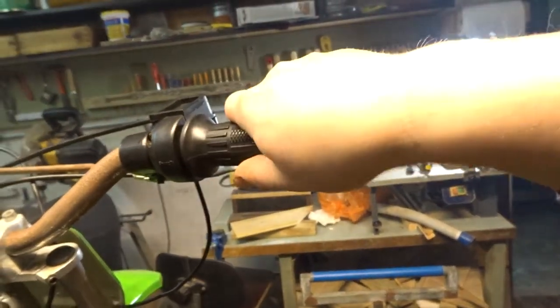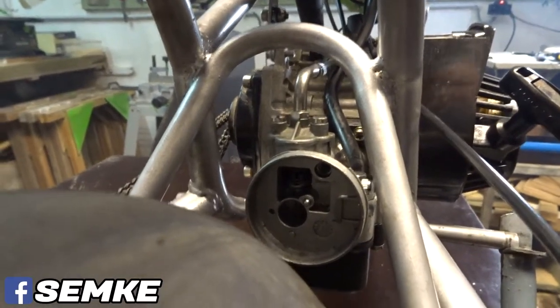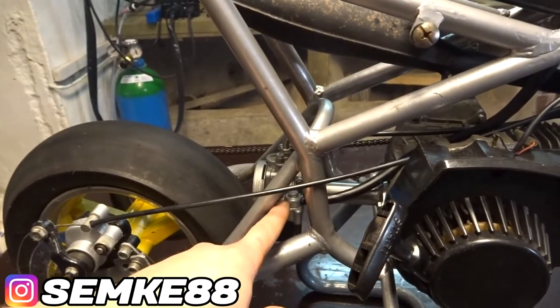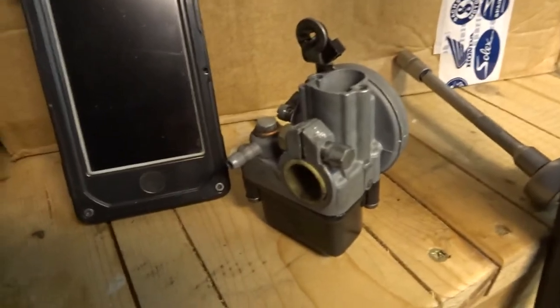The throttle is connected — as you can see, it moves up and down. But what you may notice is this is not the smaller carb. This is the 13mm carburetor back on there. The old one is right here. For some odd reason the smaller carb doesn't work as well — if I give it throttle it just dies — but with the 13mm it revs up really high and sounds pretty good.